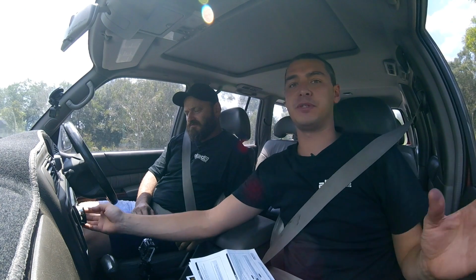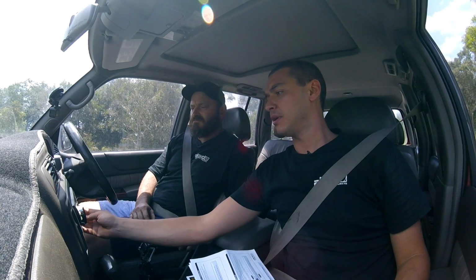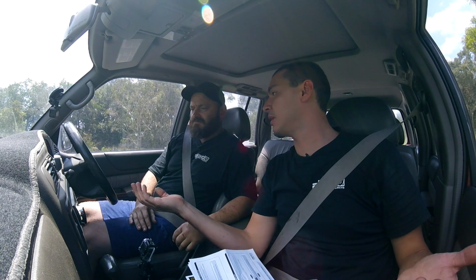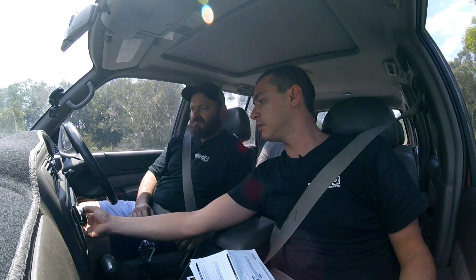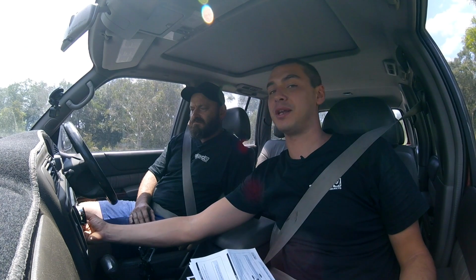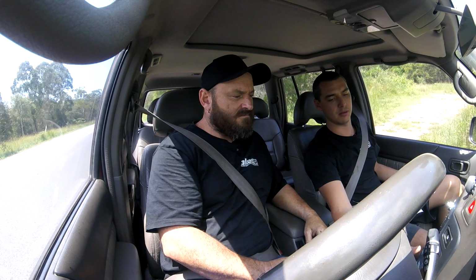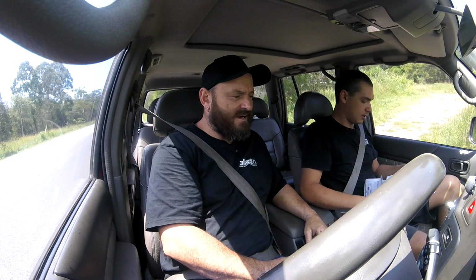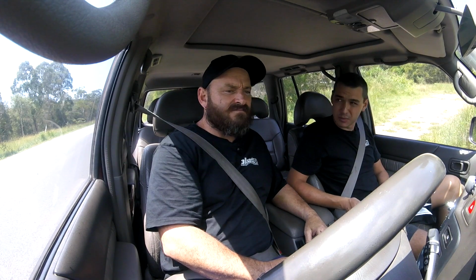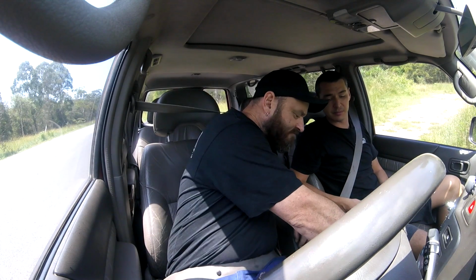So duty cycle goes from 0 to 100%. 0 obviously being the least, 100 being the most. In theory, 100% would be 50 PSI if you can produce that. But we're really not too sure what it's going to get to. So starting at a lower number, let's go 15. Gain we can play with. You going to play with it now? I reckon just give it a hit and see what we get to.